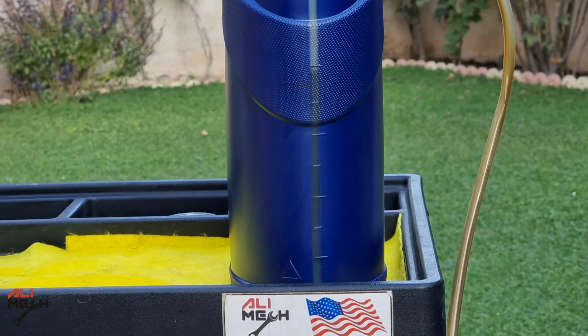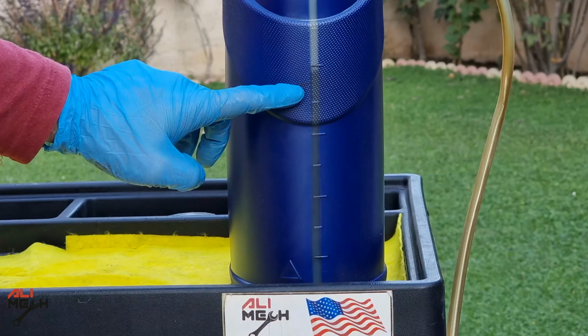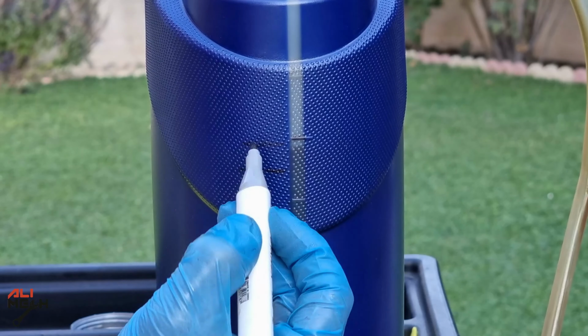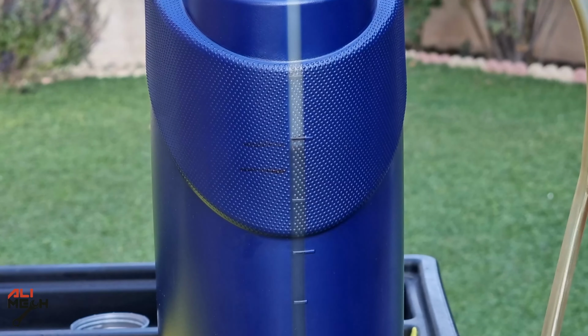Tighten the bolt back and then clean the area as I always do. Okay, here is how much came out with the oil pump extractor. And here is how much came out from the drain bolt. It's about 200 milliliters. If you're wondering, Toyota Camry's engine oil capacity is 4.6 quarts, which is 4.35 liters. Why only 4 came out? Well, the rest is still in the oil filter.